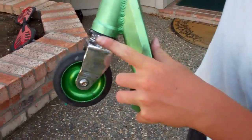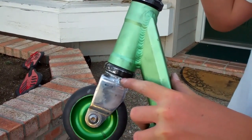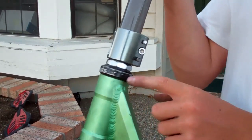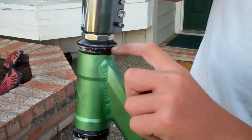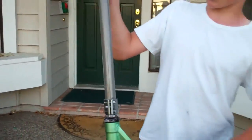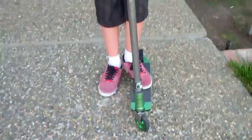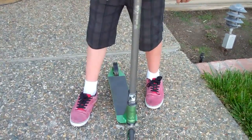So that's how you install a threadless headset. Going from top to bottom for pieces: we have the crown race on the fork with the fork spacer, the bottom cup, the sealed bearing. Up here we have a top cup with the sealed bearing, and in between the top cap we have a compression ring between the cup and the top cap. Then we have a lock nut in silver. I already showed you how to install it and it's pretty smooth — you can hear that. Drop test. It's pretty solid. Thanks for watching.